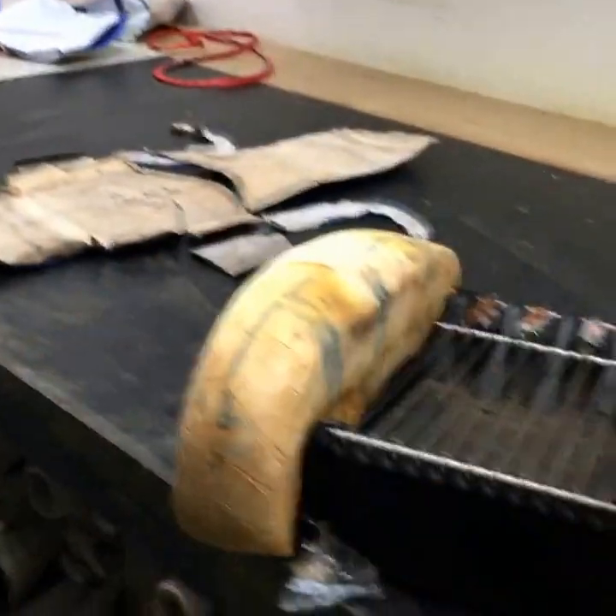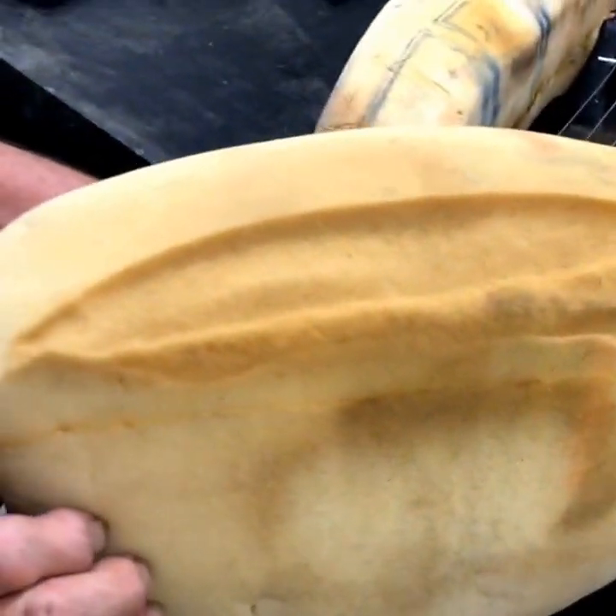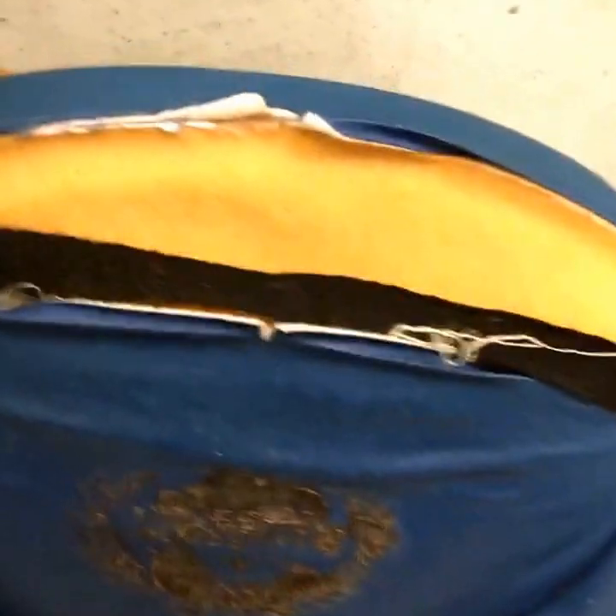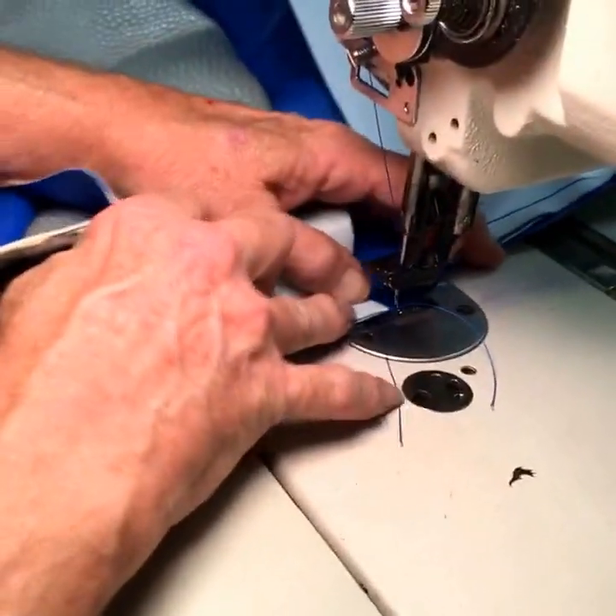This one's going to need a little repair. The headrest foam is damaged here, so I'll cut out this section and replace it with new foam — make it look like new. That headrest split open on top and completely failed. We'll cut out the bad pieces, put a whole new piece on, and recover it with new stuff. Why don't you show them what you've sewn on this one? The color combination is beautiful. This is the center section of the seat bottom — I take it all apart and use all the old pieces to make patterns for the new pieces. All these pieces are numbered so you remember where they go back. These are the poles that hold it into place.